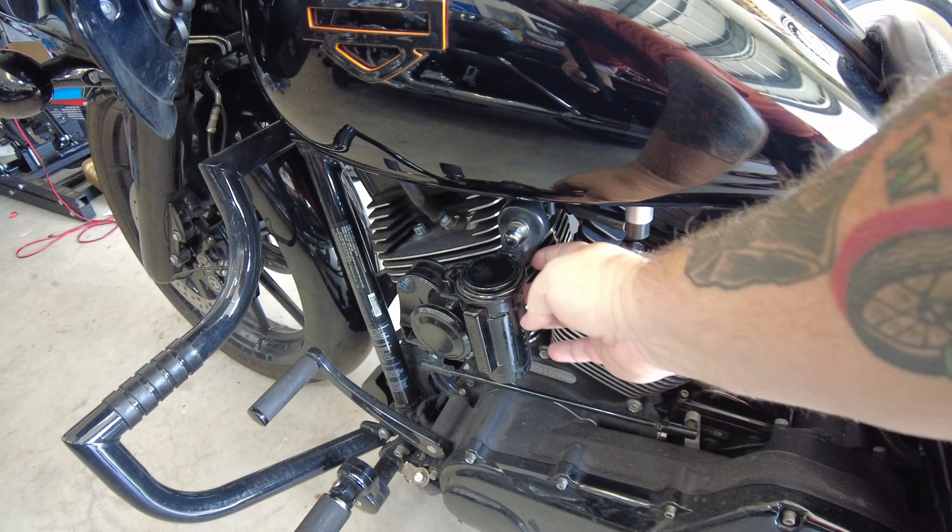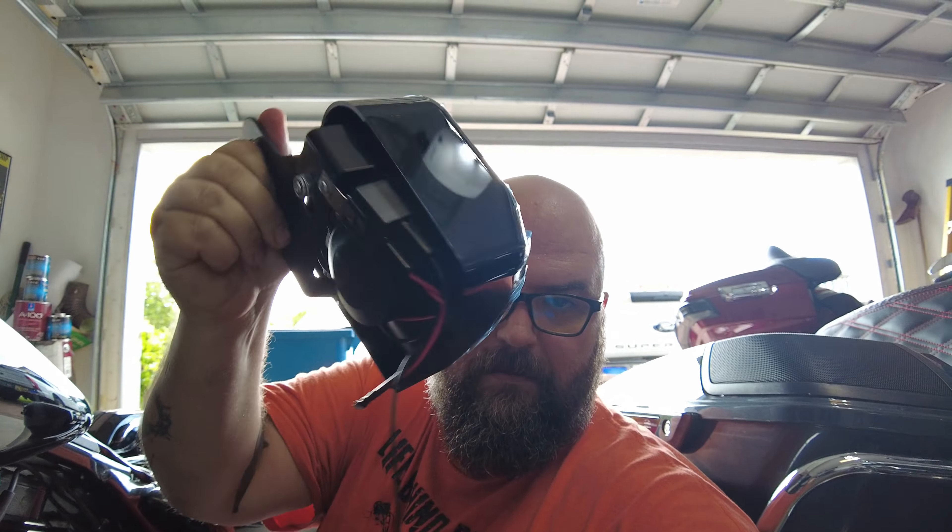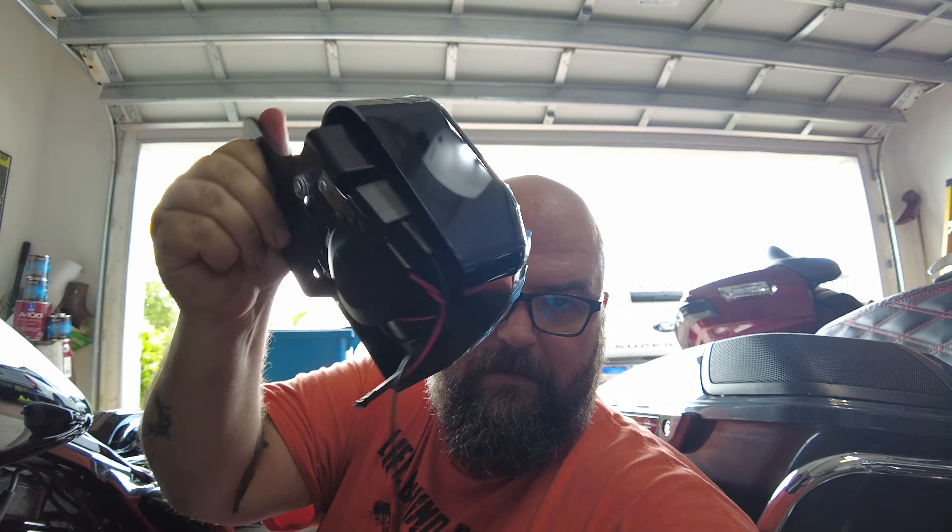First step is to take the single bolt nut off that holds the horn on, and then just unplug it from the back of the horn — positive and negative little clips. So you've got this nut here — hilarious that somebody spray painted it black to try and extra black it out. We're going to take this off. Down here on the back side there are two plugs — you just unplug those and this comes free. Looks like somebody spray painted this black too. The Pro Beast hangs from there and has the same positive and negative terminals, but then an extra 12-volt line that will run up under the tank and plug into the battery to give it enough juice to be nice and loud.